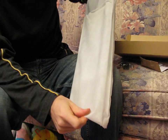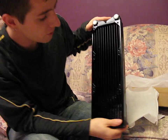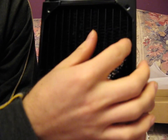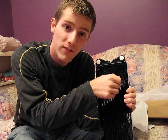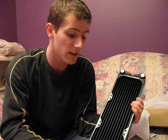Here we have a nice papery-clothy shroud over a tissue paper shroud over the radiator itself. SwifTech MCR series rads are a quiet radiator, meaning there's a low FPI — fins per inch — count. That means it's optimized to work best with quiet fans, versus competing radiators which might have more densely packed fins that perform better with high CFM fans but not nearly as well with low-flow fans. I'm going to be using relatively low airflow fans, some Yateloons, so this is definitely the optimal setup for me.